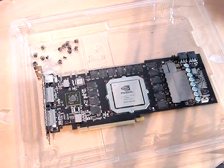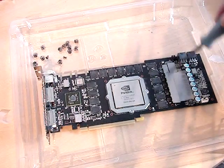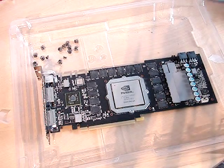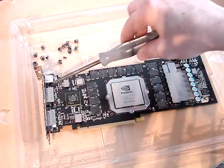To remove that, you need to unscrew 12 screws on the back of the card from the circuit board, and — not obvious — you also need to not forget two screws on the bracket. So 12 on the card, two on the bracket.